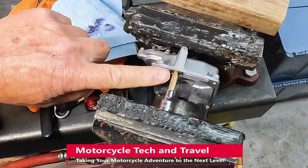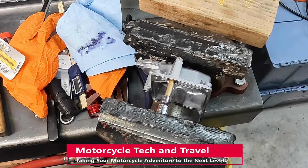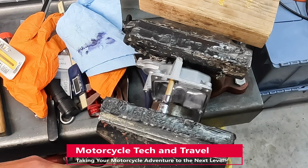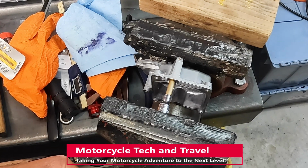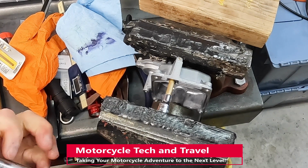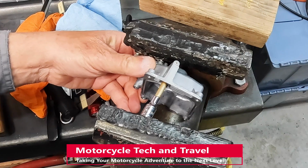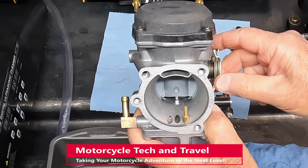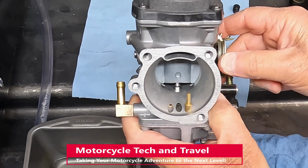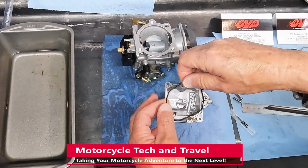This gap will be closed. Apply pressure slowly to avoid damaging or, at worst, breaking the float bowl. A thin coating of superlube might relieve strain here. I did this dry and allowed the parts to adjust to each increment of pressure. The nozzle base is now flush with the float bowl surface. A final check of the spray pattern reveals that the nozzle is pointed directly at the center of the needle. This is the final assembly of the float bowl and carburetor body.